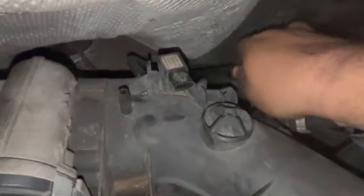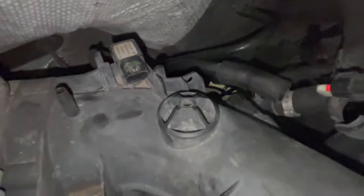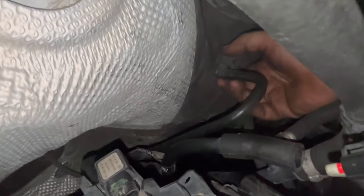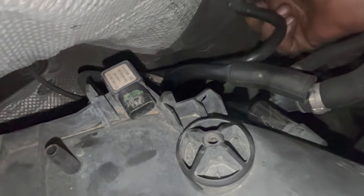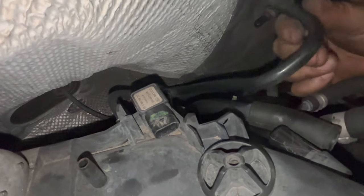There is a PCV hose — the primary PCV hose runs from here back to the PCV valve on the valve cover. There's also a hose that goes into the rear of the intake — it's the brake booster connector. It goes to the firewall below the round brake booster, and it's simply squeeze and pull. It's a little bit brittle and delicate, but it'll stay connected, and when you put it back you just push it on and it clicks.